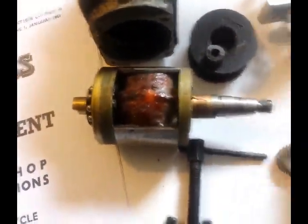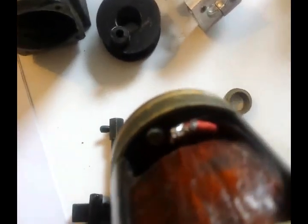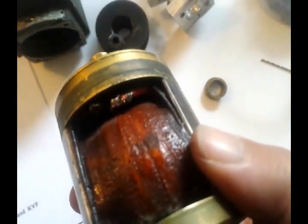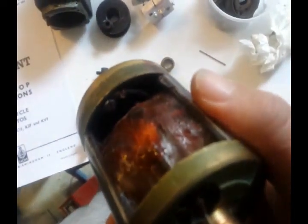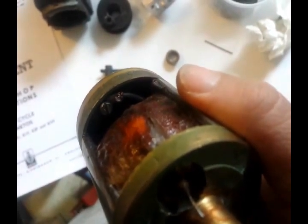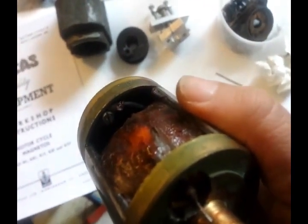I went back and it's done — and it was not easy. I've reassembled it. As you can see, there's a newly sleeved live that side, and an earth in there. You have to take this thing apart, although the procedure is actually relatively simple once you get into it — it's just getting in that's a problem. It's really difficult to get in there. I still think it's possible just to do this without taking it fully apart. Once you get it apart, it's actually quite simple; the instructions are overly confusing. Essentially, what you need to do is take this thing apart, pull the bearing off that end, followed by the slip ring.